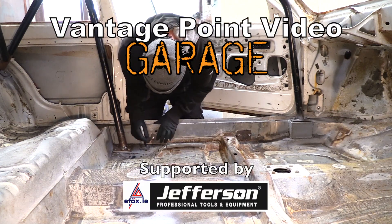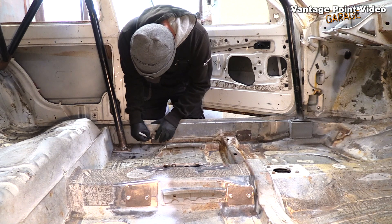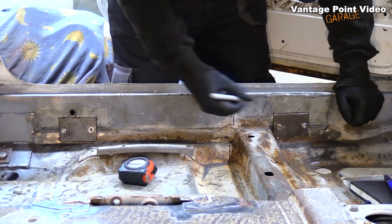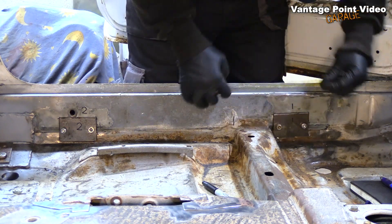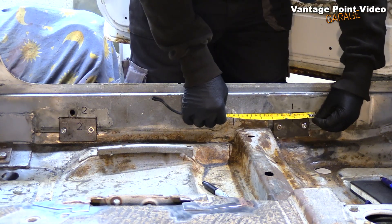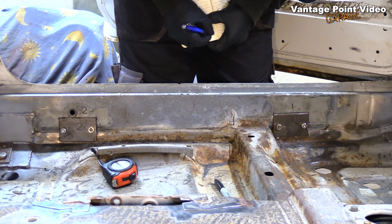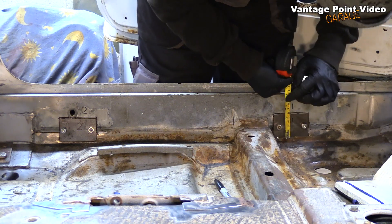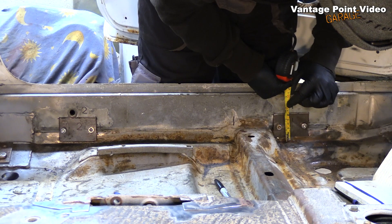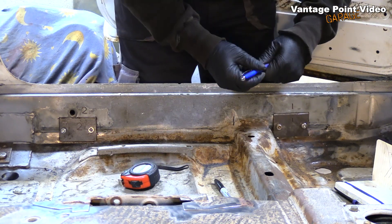The little plates positioned on the inner sill and on the tunnel in the centre of the car are the end plates for the lateral supports that I'm going to weld in, going below the brackets that hold my seats. I need to put counter plates welded in behind these plates. These are what will be attached to the car, and then the end plates will actually be demountable - you'll be able to unbolt them. This is important because I'll paint the car with these supports in position but then be able to take them out and drill them and put in inserts in the exact places I need for the seats when I order them, doing that away from the car so I won't destroy any of the paintwork.